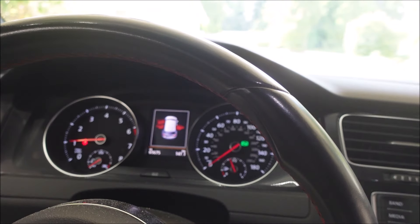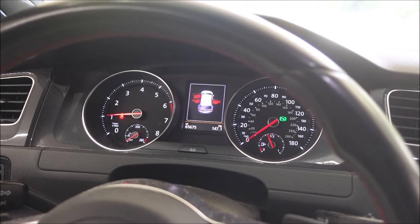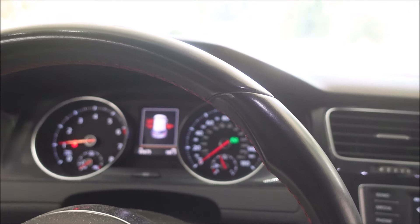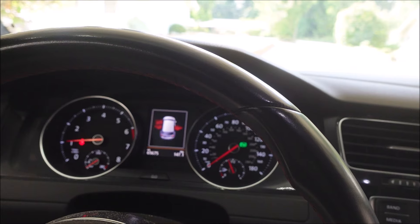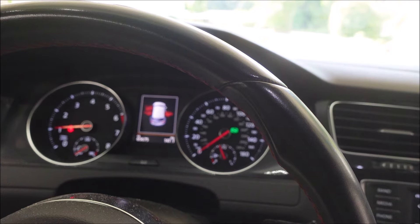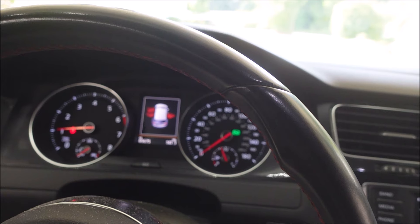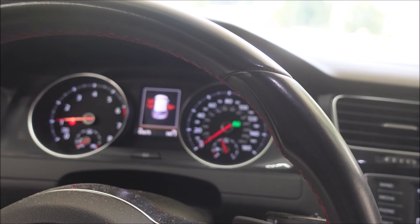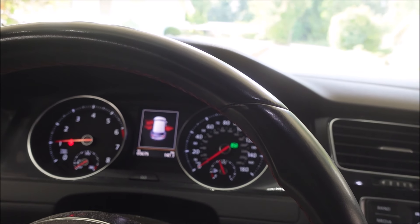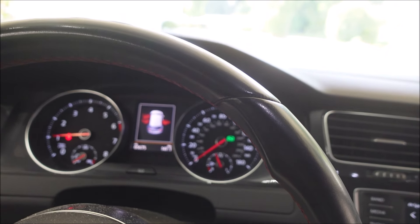The problem we were having with this car at 65,000 miles — actually it happened well before that. What it does is when you drive somewhere, you shut it off, go to the store, go back out and it's still warm — it doesn't want to start. It'll eventually start and misfire, sound like it's running on two cylinders, and go into limp mode. You shut it off, restart it, same thing — eventually after four or five times restarting it, it'll run normal.